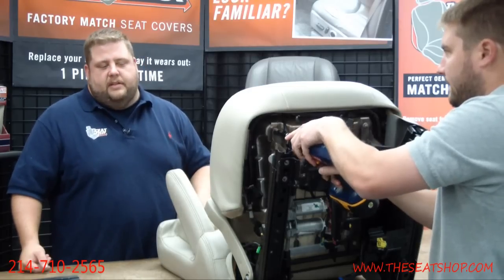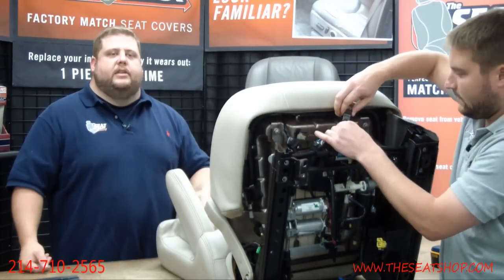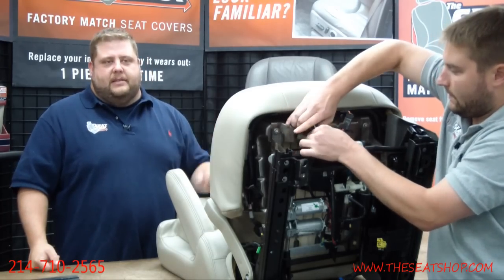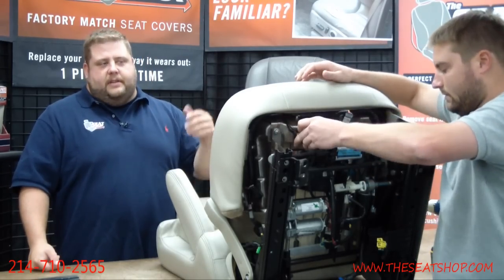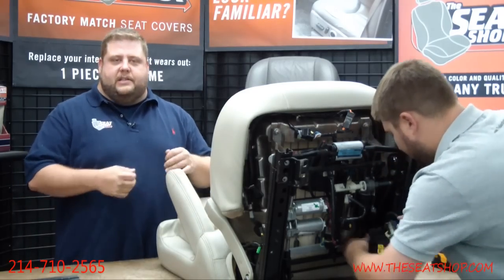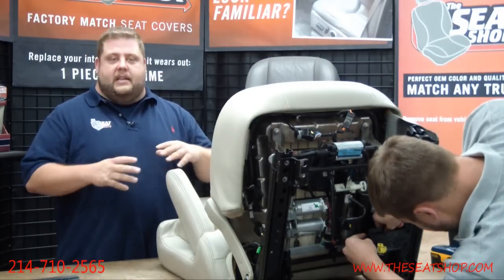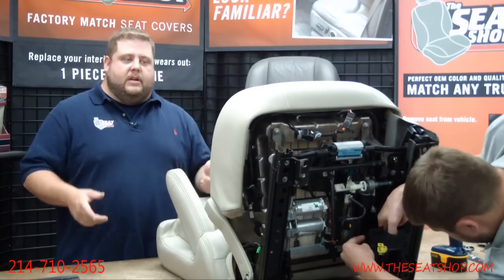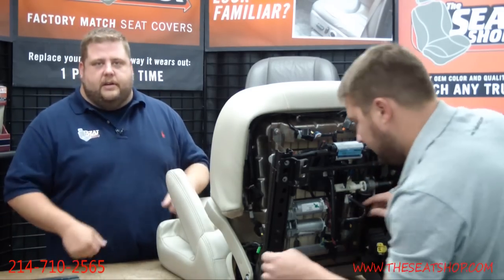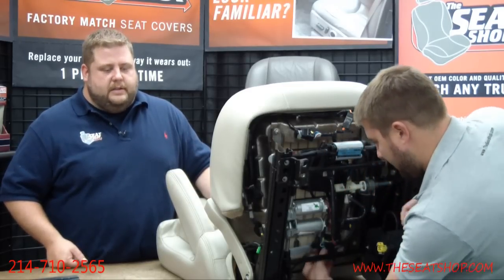You'll instantly know if you missed any of the clips, any of the power clips underneath. Once you've got the seat back in the truck and you plug it all up, start the truck up and drive around for a minute — your airbag sensor light will go off. If you see that light go on in your dash, there's nothing really wrong with the airbag. It just means one of the connections underneath is loose. Any connection that's undone or loose will cause the airbag sensor to go off. So if you see that, just pull the seat, go through and check all your connections, make sure they're all snug and tight and that sensor will go off.